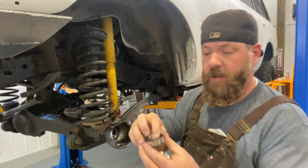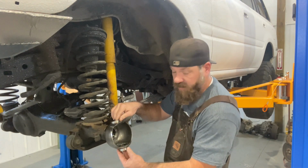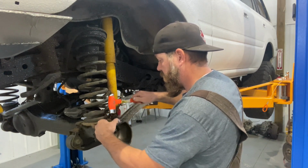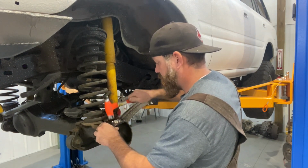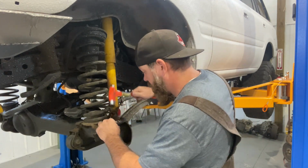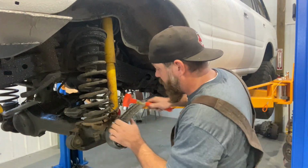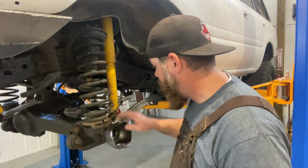So you'll need to put the tapered thinner side to the top, and to the bottom down here, if that makes sense. So just make sure that your taper is facing outward. And then just take a hammer, this little 16-ounce one, and you can just start tapping them. So that's the races put in here.